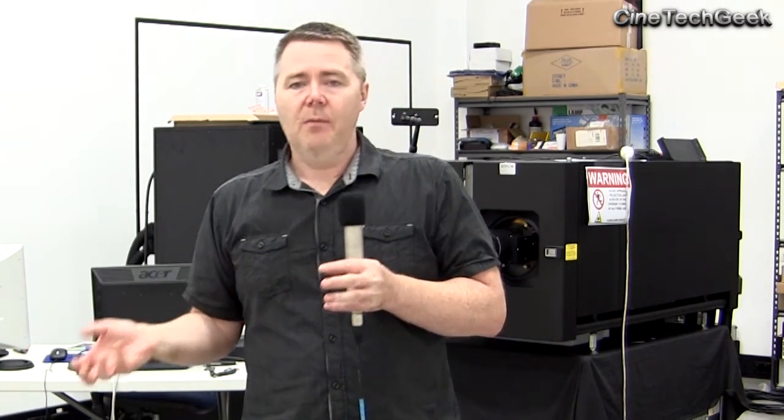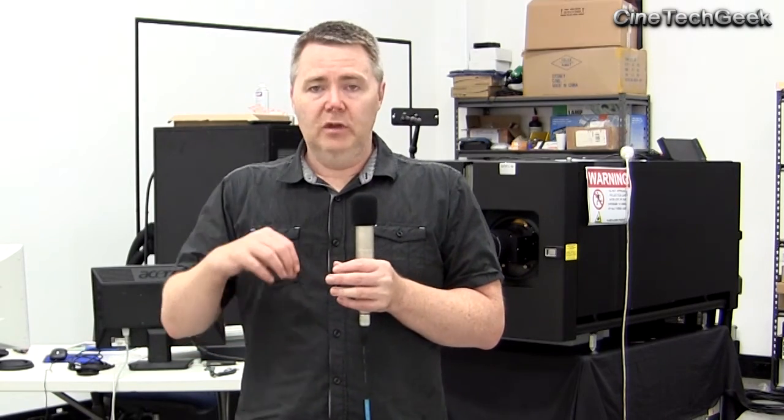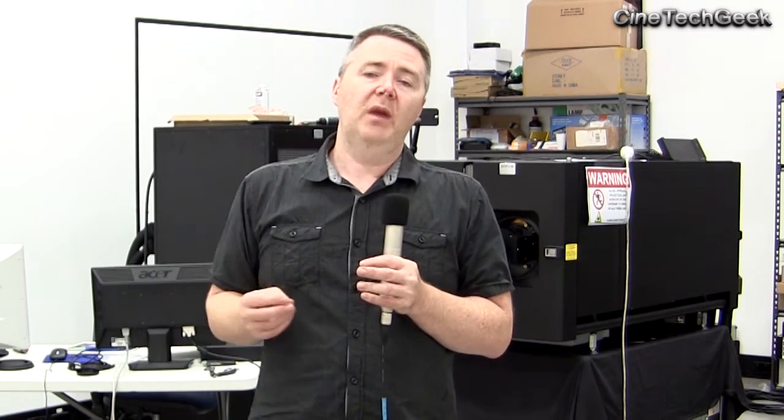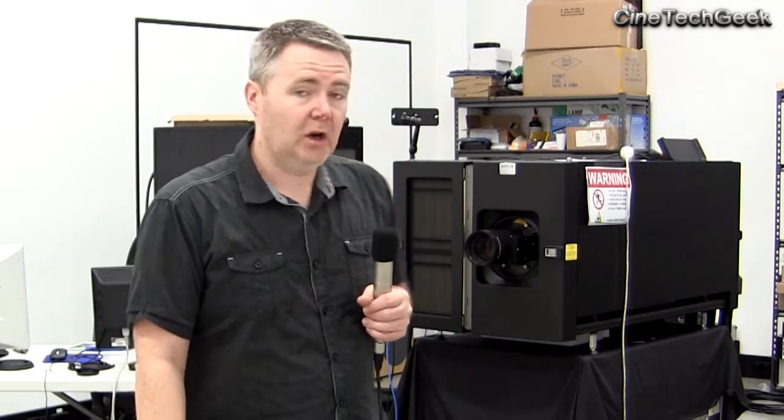When you talk about a 6P laser projector, in 6P mode we're not really at REC 2020 — the laser projector has to be in a 3P type mode. That's important if you're into laser projection. It's one of the reasons Barco has done well, because their speckle mitigation technology seems to be performing the best of all those projectors. Even in 3P mode — since 6P is a form of de-speckling — the speckle characteristics seem to be one of the best on the market in that type of mode.